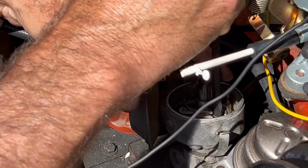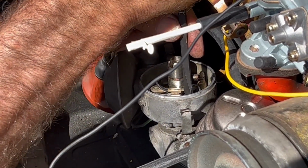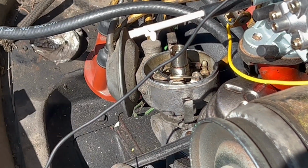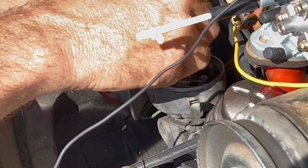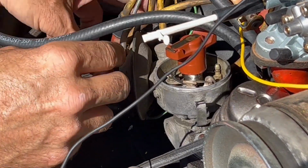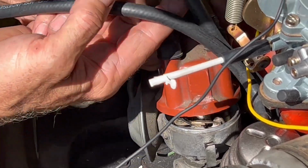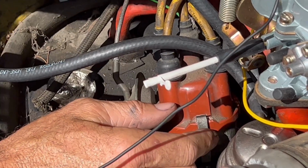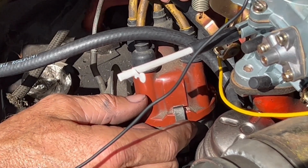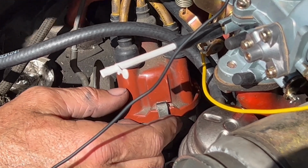It usually takes a few times, a couple hits. And this you adjust when the engine is a little warm? Yeah. Or it doesn't matter? The valves you need to do dead cold. Oh, okay. Basically everything else you need to do when the engine's warmed up. And this is adjusting the dwell time for the spark buildup, basically. Yeah, it's adjusting the points. Okay.